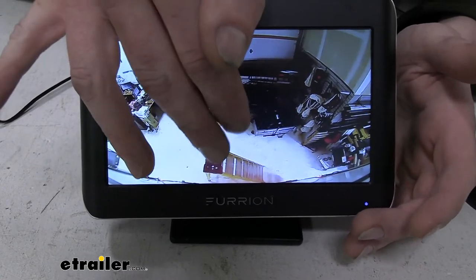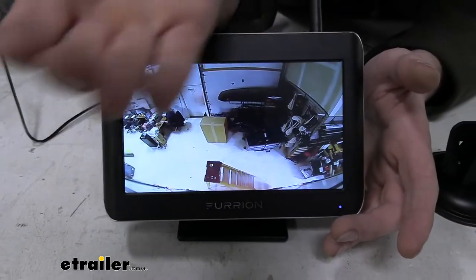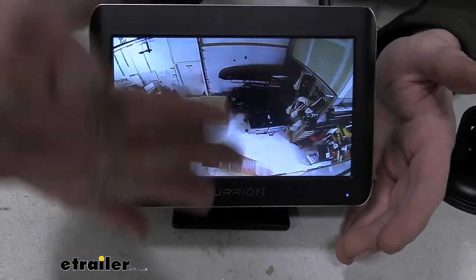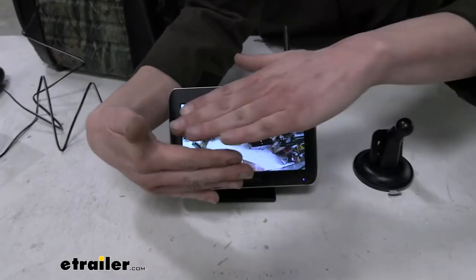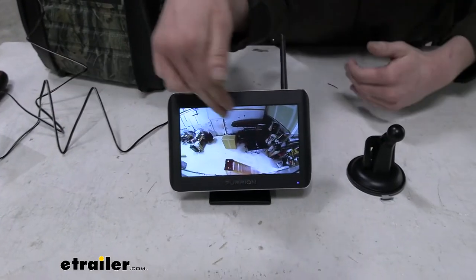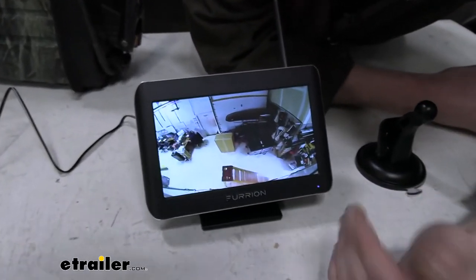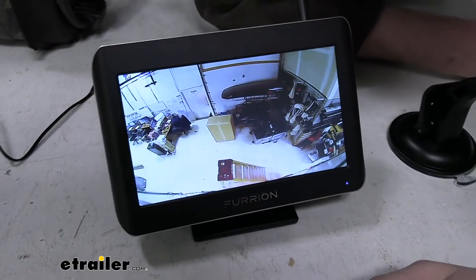I took the lens off for that center light, and I just put some black electrical tape on the inside of the lens, just right at the very top edge. So we're not blocking any of the lens where it's facing the back of the trailer that anybody would see, just that top edge there, and that helped to reduce the red blowout. You can still see just a little bit of it there, but it did make a pretty big improvement on the clarity you'd have on that rear camera.